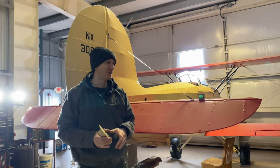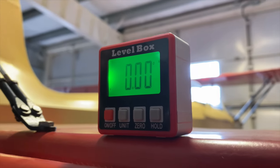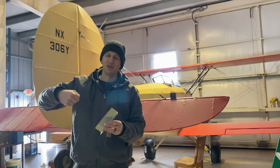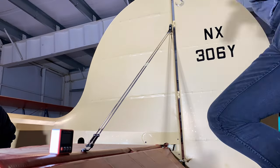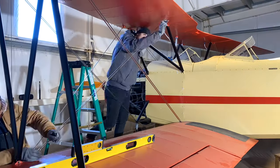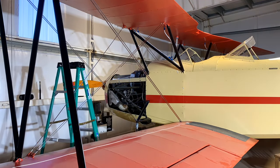It's time to do the rigging. This airplane was already rigged but we're going by the manual. We're doing the tail right now — the airplane is leveled with the tail up, basically how it would be in flight. We have a small piece of angle iron, hook the fish scale on, and pull to one inch of deflection. Through our formula we can see how many pounds of pull on the fish scale corresponds to one inch of travel for the required tension. This was my first time rigging an airplane with flying wires — it's a lot different than rigging with simple wing struts. The wires all work off one another, and there are 14 on just the outer wings alone, which makes for a lot of tweaking.